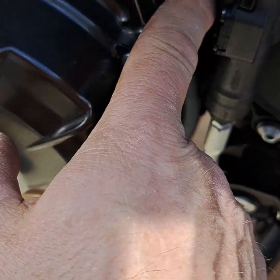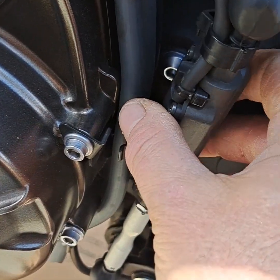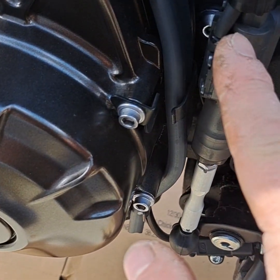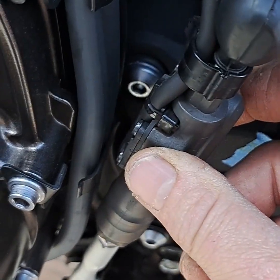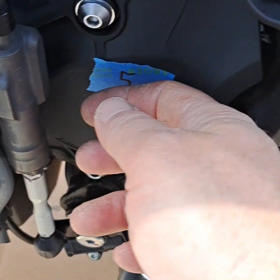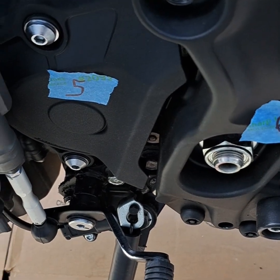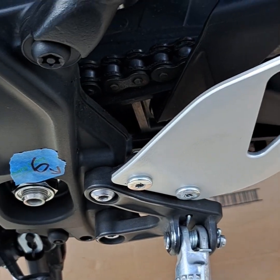This one here is the one you're going to need the wobbler for — it's a tight spot and I don't want to disconnect this linkage here for the shifter. I've done it before and it is possible — you can get that wobbler with that socket and get this thing out right there. It's kind of hard to pop in and out of there, but it will. So don't freak out, it's a tight fit. Get that off and you'll see where the front drive sprocket is. There's a lot of crap that gets built up in that front drive sprocket, way more than any other spot on this chain.